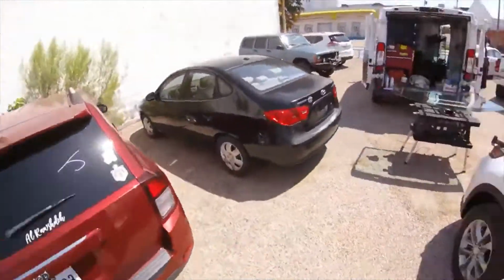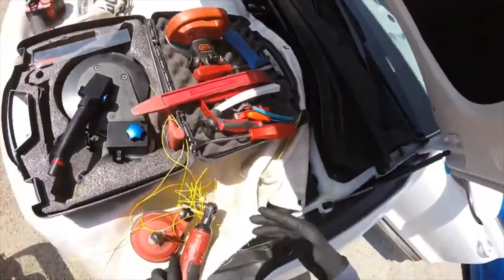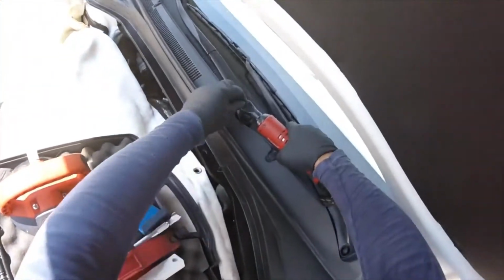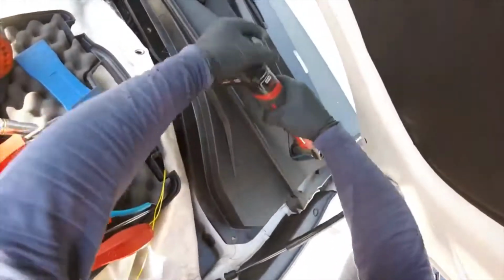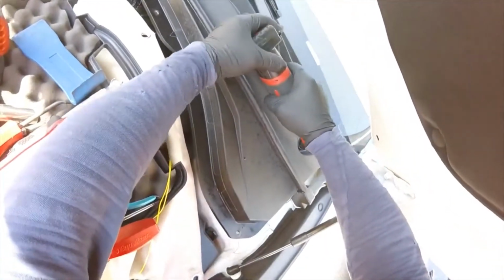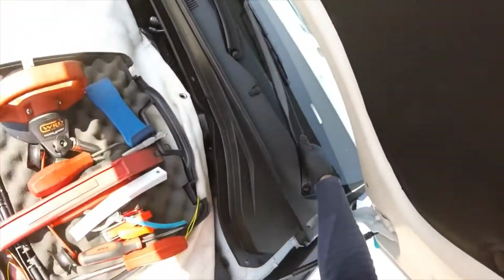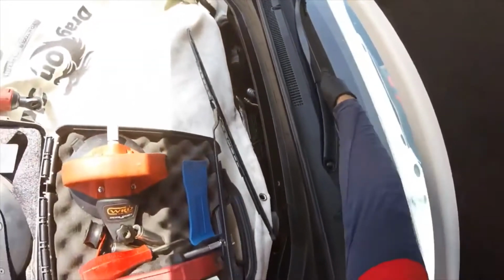Okay, let's start by stripping a couple of parts, because I was just charging my camera. Remember, the same covers, the same styles, the same clips as the other Santa Fes. The only thing we maybe don't have is those ugly clips on the bottom, so that's a good thing. It's the same thing, nothing changed here. I already covered the corners on the hood because I don't want to scratch it when you pull the moldings.